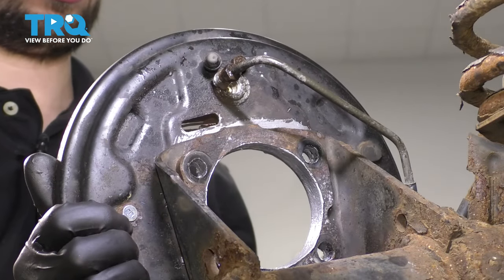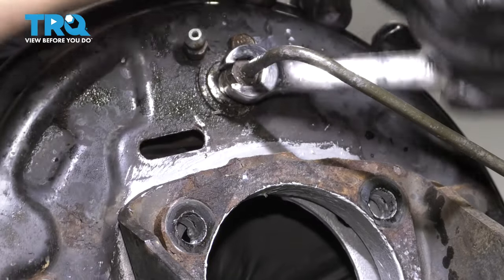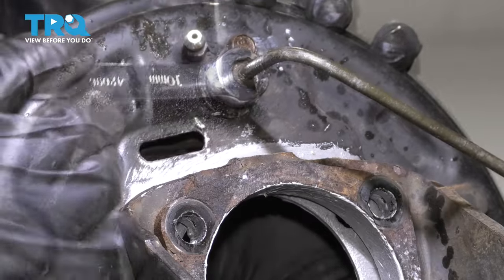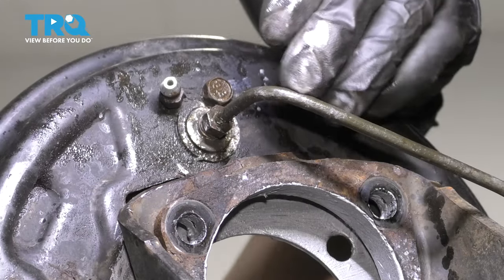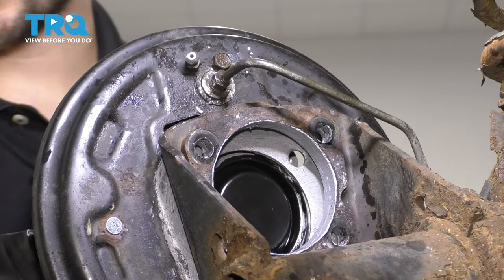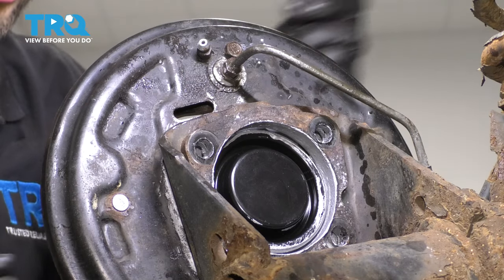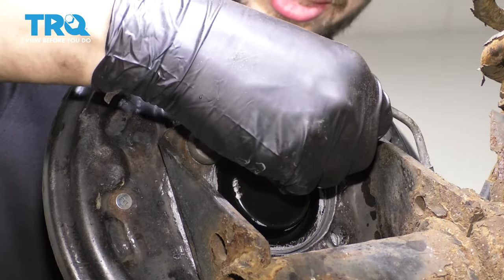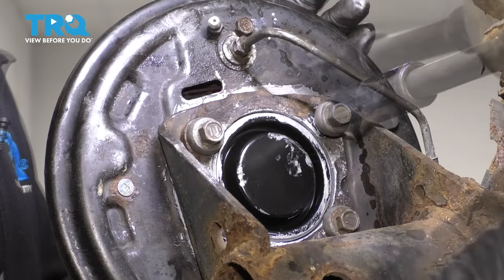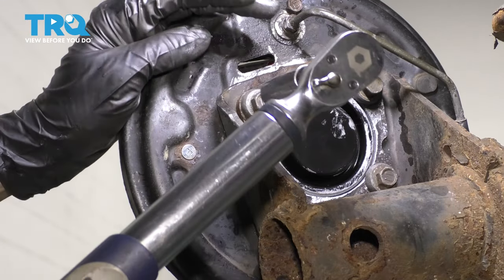Let's put this backing shield back and start the brake line back in. So grab the wheel bearing and put it through all the way. There isn't much to see on the front side, which is why I'm showing you the backside — at least here you can see how it needs to line up. Start in all of your bolts by hand; you don't want to cross-thread any of these. The torque for this is 45 foot-pounds. I went in a cross pattern when tightening, and I'm going to do the same when torquing, so the wheel bearing and backing plate can seat themselves 100% even.